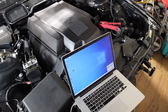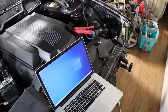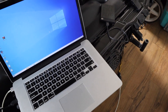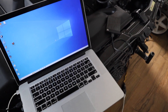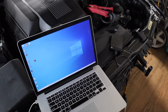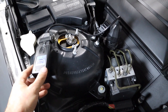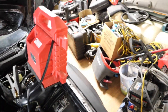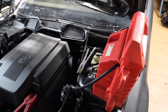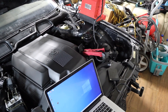I'm gonna show you what you need in order to do this conversion. You need a laptop computer running Windows 10 or Windows 7 — it doesn't matter. I have a Mac running both systems, but you need Windows for this. You need a BMW scanner cable, which I got from Amazon for about 30 bucks, and you need an adapter for it. I've also plugged in a battery charger so the battery stays good — you don't want the car to die in the middle of coding.